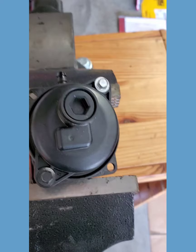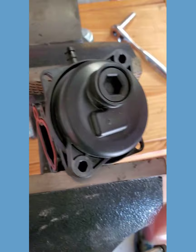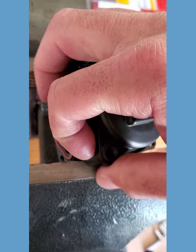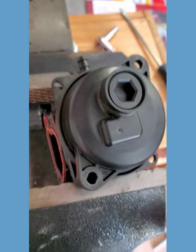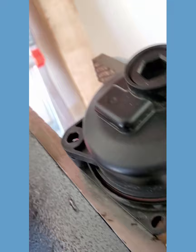Now we can take those two bolts out — okay, these are 7mm bolts. Take them both out. Now once you get them out, these bowls are usually sealed with a rubber O-ring around them. It's a fairly tight fit, so you're going to have to normally rock them back and forth or even pry in between the two parts here. As this carburetor is not that old, I'm not expecting it to be that big of a battle — but I'm already being proven wrong. So I'm going to have to get the screwdriver and gently, evenly pry a little here, a little there, back and forth until you get it off. After a little back and forth, it will come loose — and there, you can see that brown O-ring there, a big ol' honker.